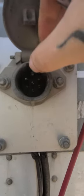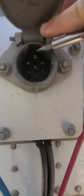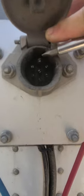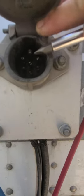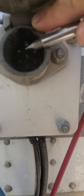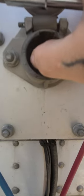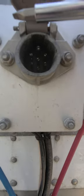Not too much force. I'll explain these pins: the top one is generally your power — that's the power that does all of them. The bottom one is your ground. The middle is usually your ABS. The two top right and left are usually your running lights, and then the two bottom right and left are usually your turn signals.